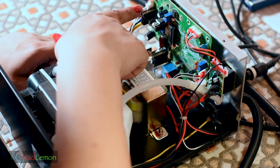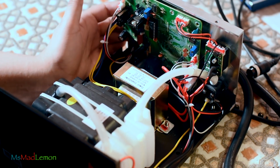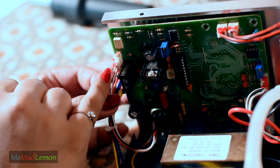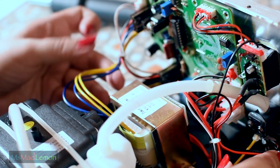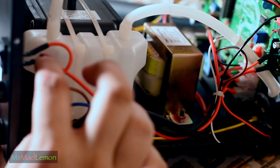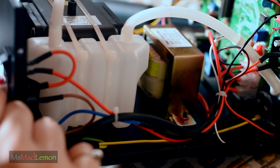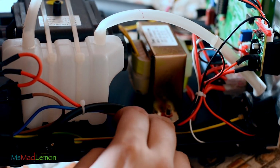Okay, there's something I noticed straight away. Okay, hold on, let me show you. You notice it there? That is not good. You can see the bare wire there. Okay, everything else seems to be fine. Transformer wire, there's no bare wire there. The pump is fine, the casing is grounded, everything here is good. Switch, fuse, that's good. Somebody was complaining about the fuse being dislodged and out and stuff. It must have been bad transit. This one is fine.